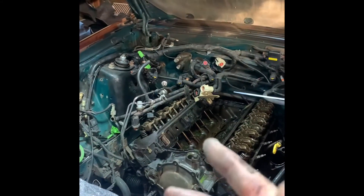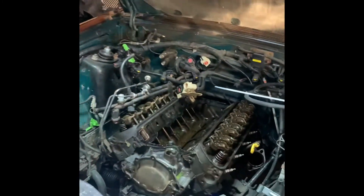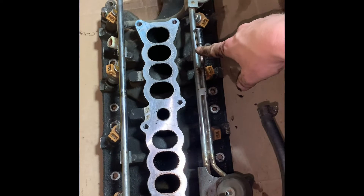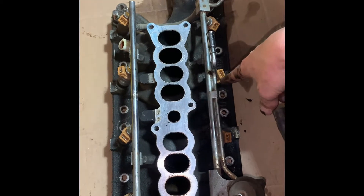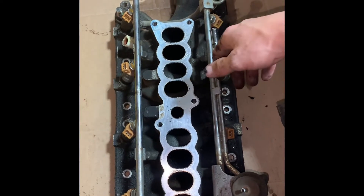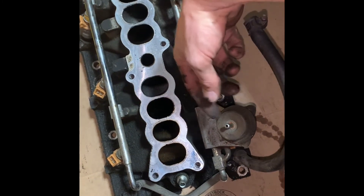It's a little milky — this is why I wanted to completely rebuild this motor. It just wasn't worth it to do more bolt-ons. I already had it somewhat out once and it kept leaking oil. 30-something years old, it needed to come out. Here's your lower intake manifold. The fuel rail is good for up to 500 horsepower, so I'm probably keeping it. Stock 19-pound injectors — always orange — I'll throw those on eBay. Stock fuel pressure regulator had no issues but it's going on the shelf.